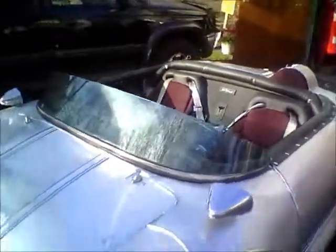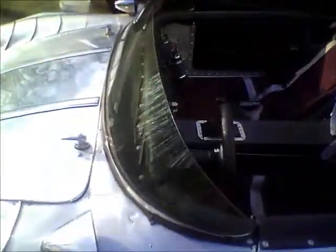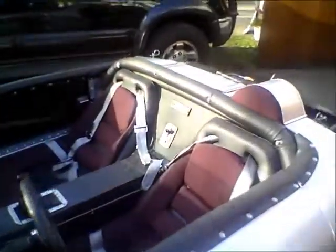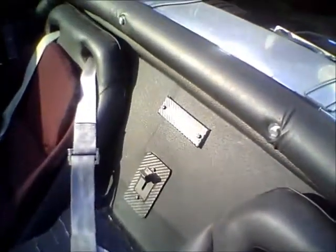The windshield I cut down from a 1957 Chevy rear windshield. In Connecticut you need safety glass with the stamp on the side confirming it's shatterproof and meets DOT standards — this one does. It's a tiny bit too narrow, so I'll probably put a piece of plastic molding on top to pass inspection. That is the kill switch — one of several safety devices.